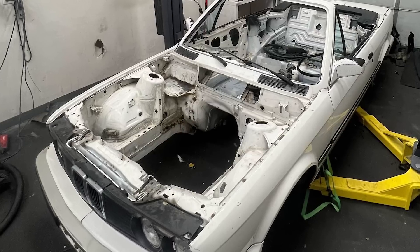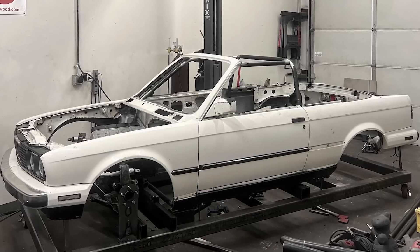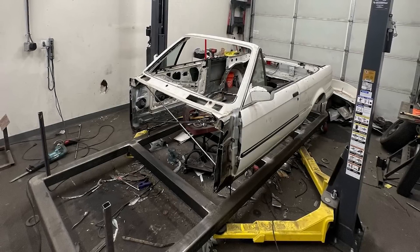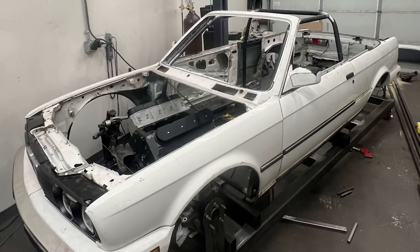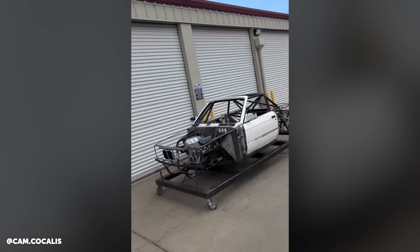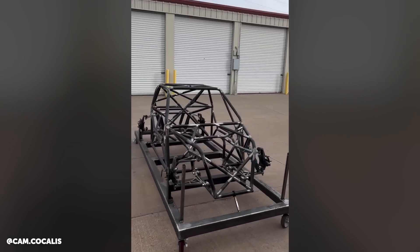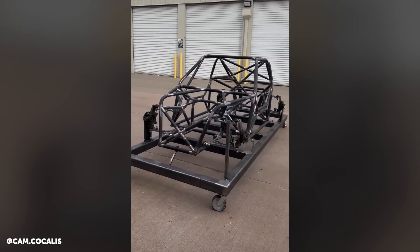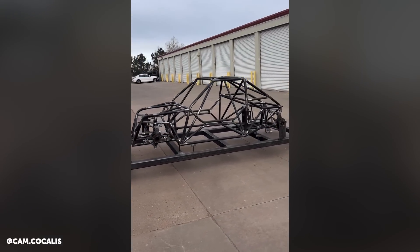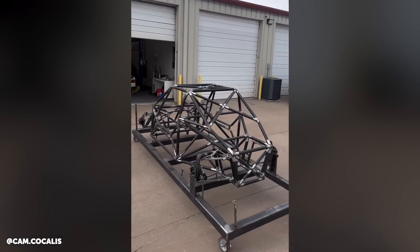My basic process is: put the body on a chassis table, make hub jigs to mount the hub position, cut everything out, then design each corner knowing exactly the suspension mounts needed. Make the tubes that hold those suspension mounts, then build all the functional tubes into junctions. It's a rudimentary, old-school way — easy to mentally process. You understand what's going to happen, and using a proven geometry like the C6 Corvette means if you get it right, it'll act just like that. There has to be some stable factor; you can't push the limits infinitely when you don't know what's going to happen.